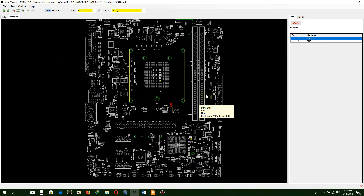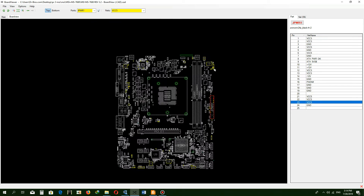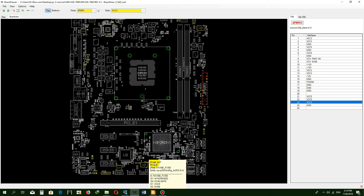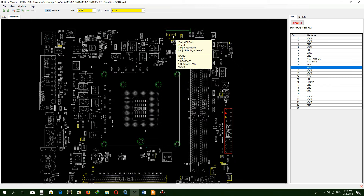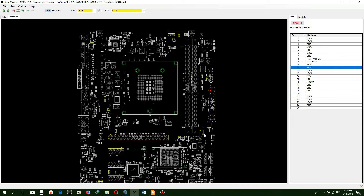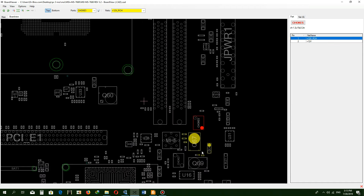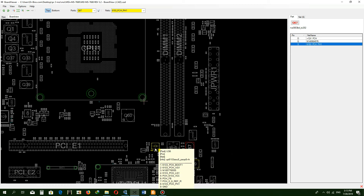I have checked this sub-voltage. The next main voltage to check is plus 5V switch. Plus 5V switch enters RAM VCC Q23 which I already checked, and also enters USB VCC Q27. I can check the ohm of JPWR1 here and confirm normal ohm. The next main voltage is plus 12V switch, which enters PCI Express slots and also the CPU fan. Most importantly, 1.05V PCH VCC is generated from plus 12V switch by a MOSFET and PWM.